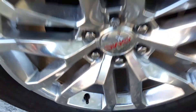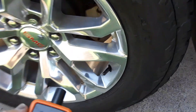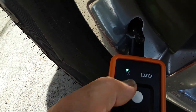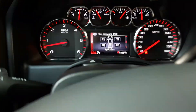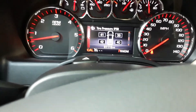I'm going to go to the right front — or the passenger front — and you have to do it in this order. Then right rear. You'll hear a horn honk each time if you're successful. Then you should have heard the two horn honks and it should have gone out of relearn mode. So they're all programmed now.